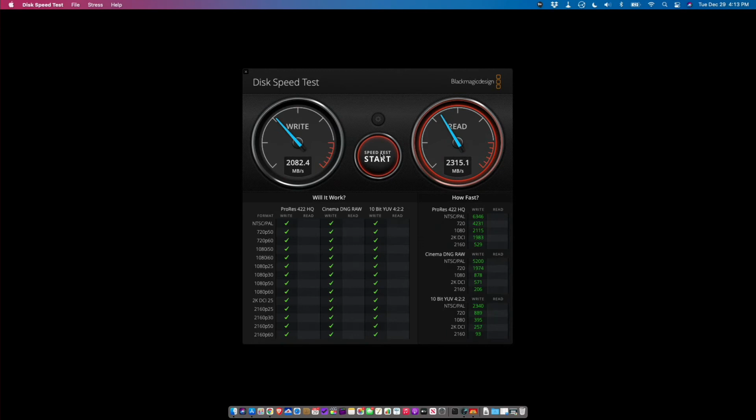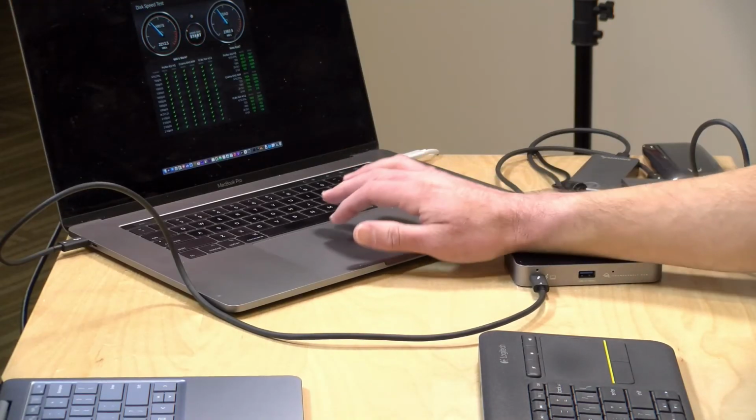So I wonder if we use 2 drives instead of 3, what happens? I'm just curious, because we're not getting much faster than the 20 gigabits out of one. And I'm pretty sure it's symmetrical 40 gigabits. It's 40 gigs in both directions, if I'm not mistaken. So we're maxing out like half the capacity, but not all of it, right? Because you should be getting closer to 5 if you were getting close to 40. So there you go. Okay, so let's kill that RAID.